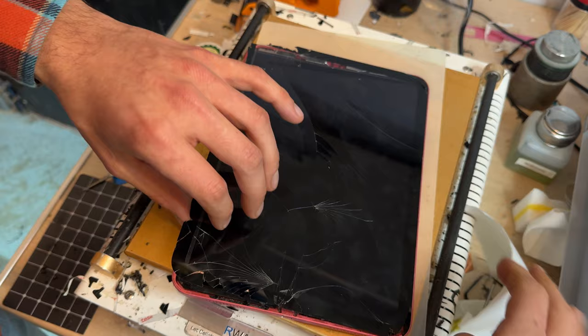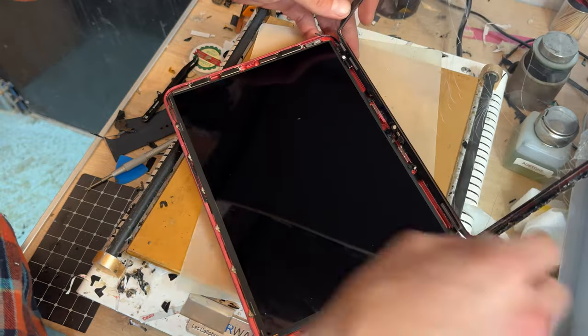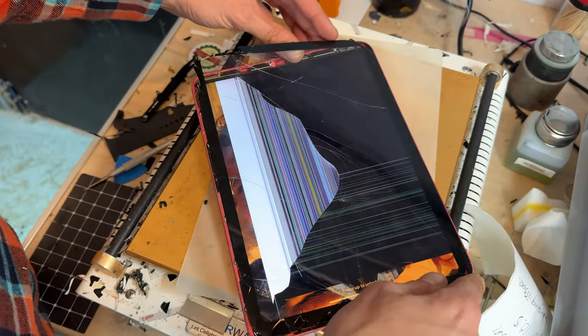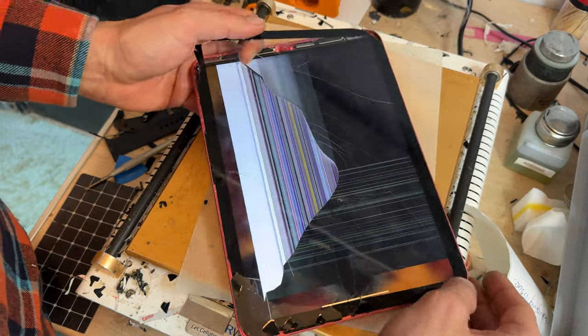Once we're into this we can see that it opens up like a book from the back cover, like all iPads, except on this one the digitizer cables are just here and here. Notice how I never touch this right-hand edge — it's not important because it opens up that way so we don't need to do anything with it. Now that it's removed I'm going to take it back to the bench where we'll take it apart further.